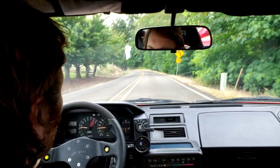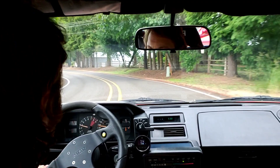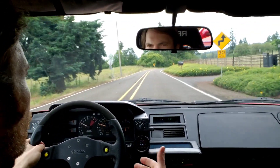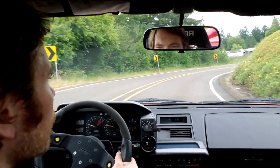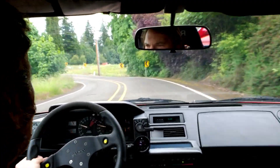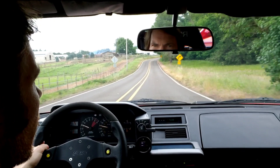So if we move to a more aggressive setting, first let me show you the throttle mapping. I'm going to just hold the throttle — there it's at 11%, 12%. Now if I move this over, it goes to 23%, right? Back down to 12%, back over to 21%. And that's all because of the way that the Motec is telling the throttle body to interact with the throttle pedal. So I can make it more aggressive or sporty feeling when I move to high slip angle settings, and I can make it more of a dead pedal for conditions like rain or wintertime.